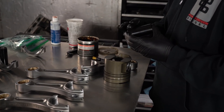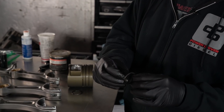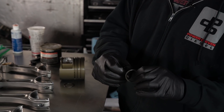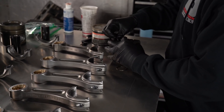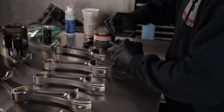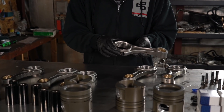The pins I coat with assembly grease. One interesting thing that comes with these forged pistons is the actual piston pin retaining clip. On a Cummins stock engine, it's a snap ring — you use snap pliers and squeeze it to hold the pin in the piston. On these pistons, they use a spiral lock. These are a lot different and don't use snap pliers; they actually spin in, and there are two on each side, so four retaining devices total. Also, this rod and cap are machined together, so you don't ever want to mix and match the cap with a different rod — this is one unit.